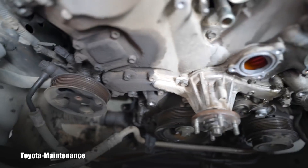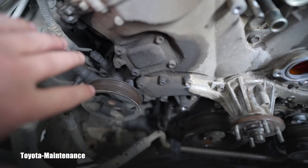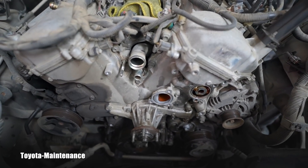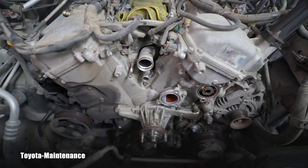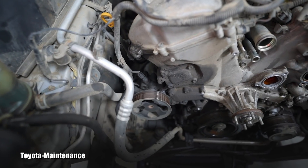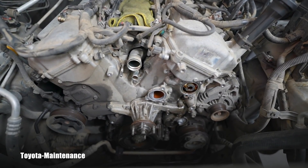I want to show you because it's more visible. I'm going to remove the water pump housing — the whole thing. Before touching it, I want to show how that oil is traveling, because not very often do I have a chance to film this. This is not a step-by-step guide, just something to be aware of. The 1GR-FE is otherwise bulletproof — a super awesome engine — but this was one of its weaknesses.